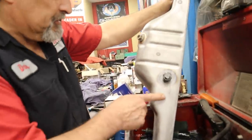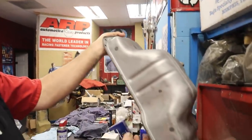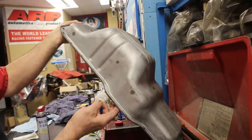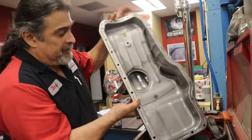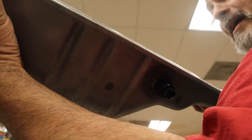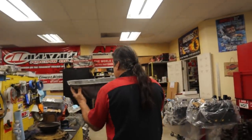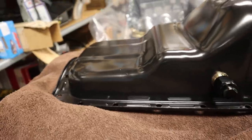Yay. And look, those little spots just look so factory, because we didn't need to overheat it or anything. That's why this silicone bronze is awesome. Wow. Even on the inside, when I went around, it had all kinds of crud in there, but there, we're completely over the edge. I see nothing, Danny. It would be instant. It's not leaking at all. And it's hot, which means the solvent we put in there is not doing anything. You'd see it instantly. Well, it's a damn good thing we decided to do the leak test.